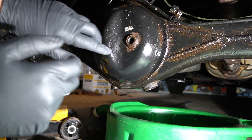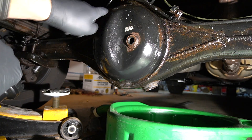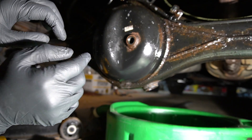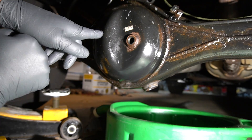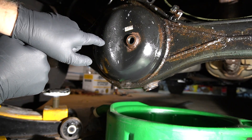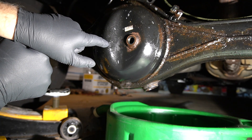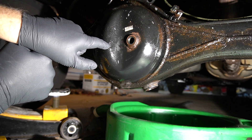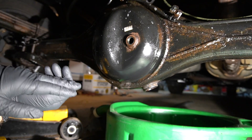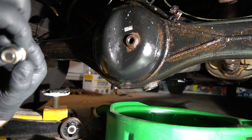The reason — just my assumption — is that the axle casing itself is the same size, but the gears on the 5.7 are bigger. This is according to the Toyota service manual for this specific vehicle, verified via VIN number. It's a 3.9 gear ratio, even though it has a tow package. On the 5.7, it's about 4.0 to 4.3 — so the gears are bigger.